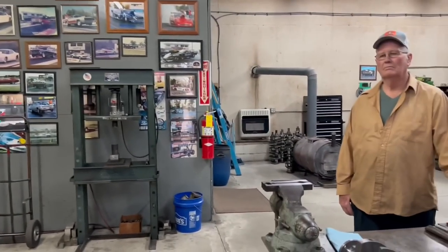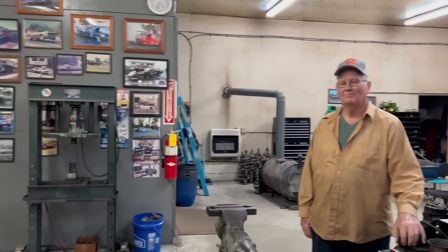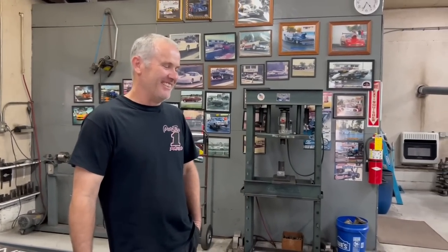This camshaft right now, I think it's got 58 or 59 degrees of overlap, but it's only 109. I put it on 110 lobe separation before, or intake centerline before. Cranking compression was not very much on the other one. It was, I think, 150 pounds. What do you normally run for cranking compression? Around 165, 170. Okay, I got you. So that's a good number. Just keep retarding the camshaft until I get to 165, 170. That's pretty good. I've had a couple motors that have been into the 200, 210, and they were very sensitive.